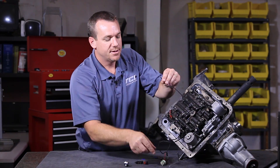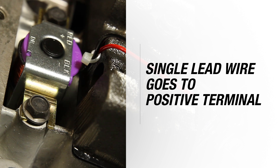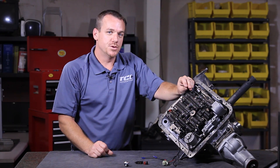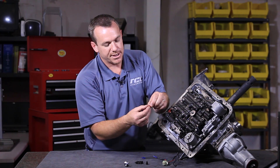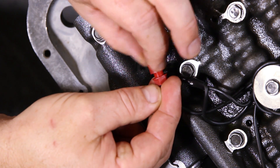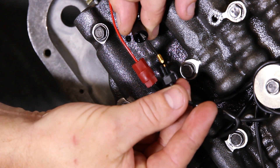This only leaves you with two wires, and these two wires are the common question. Your single lead wire goes to the positive terminal of your TCC solenoid. Now the TCC solenoid is what we get asked about — whether it's a single wire or a dual wire. You must have a dedicated two-wire TCC solenoid. If your transmission does not have one, you can purchase one online from TCI Automotive; we offer this part separately. If you have an existing two-wire solenoid that is good, we give you instructions on how to test that, and if it meets the criteria you're ready to plug up. The connectors that come in the kit include a brass terminal sleeve — you simply slide it through the spliced portion of the wire and screw together. The secondary wire left over is a jumper wire coming off the fourth gear pressure switch, and this is what will go to the negative side of your TCC coil.